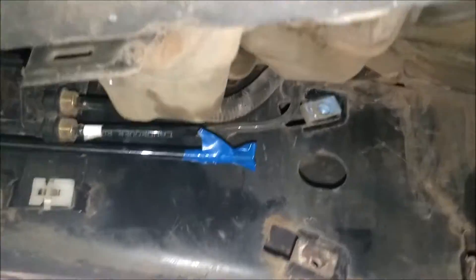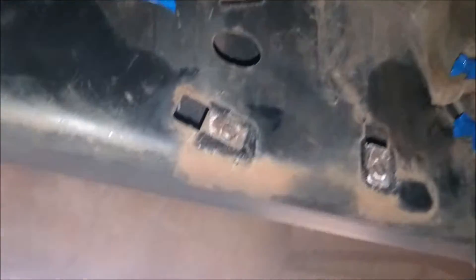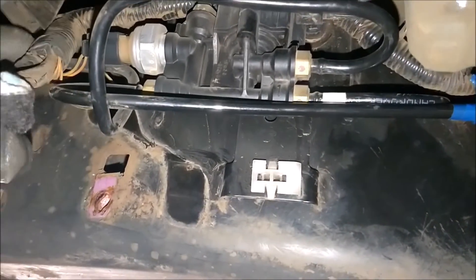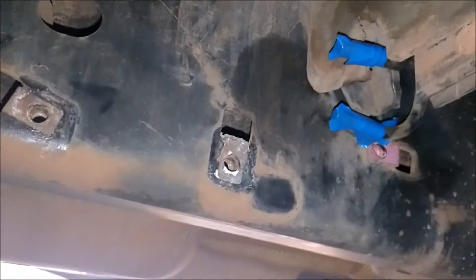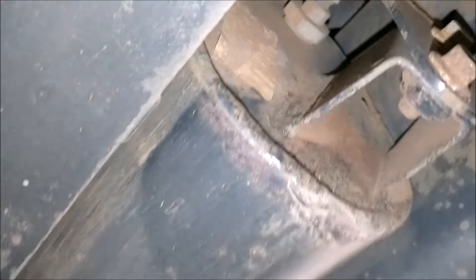This is what the vehicle side looks like, with the airlines taped over to protect them from dust and debris. We'll also inspect the junctions and any connectors that need attention; the electrical connectors have been covered to keep them away from contaminants. There's quite some corrosion here — we'll try to clean and grease those to protect the bolts from seizure in the future. Once the pump is done we'll bring it back, install, and test. We should also check the compressor tank — pretty rusty but it looks in fair health.